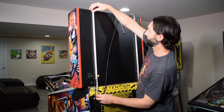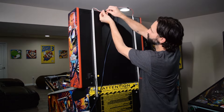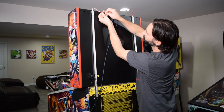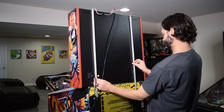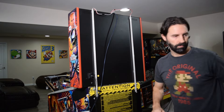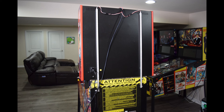The ends with the magnets 8 inches from the end of the channeling will go on the bottom. Connect the LED channeling strip to the splitter you previously installed, then repeat this process for the other side. Here you can see how the back box LED strips look when properly mounted to the back of the pinball cabinet.